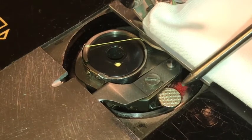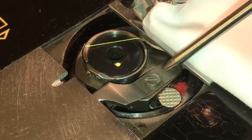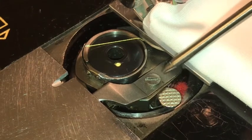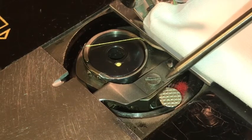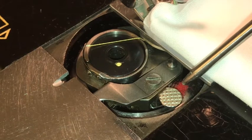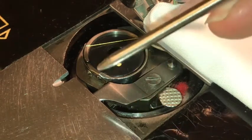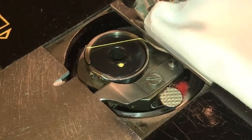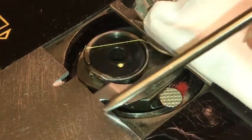What this does is it holds oil. It's in a spring and the spring is inside this bobbin positioning bracket. There's a spring in there and the spring holds this piece of felt, which is tightly pressed into there. You put a drop or two of oil on this felt when it's dry and it oils the hook and race area here.